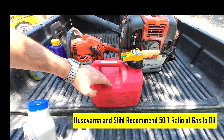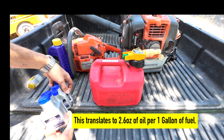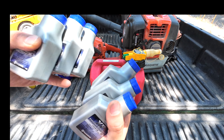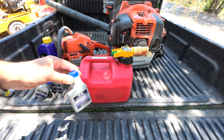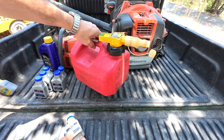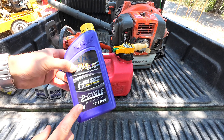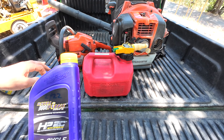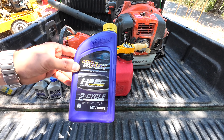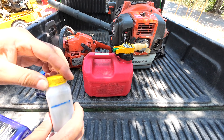The ratio is one gallon of fuel to 2.6 ounces of oil. You can get a six-pack of these Husqvarna oil containers — it doesn't really matter the brand, you just need to have a few of them. If you want to keep things very simple, you just keep buying these containers, pour it in, and add one gallon of gasoline up to the mark. That's all you need to do. I found that buying two-stroke oil in larger quantities is actually cheaper. I really like this Royal Purple synthetic oil, and I just make my own pre-measured containers. The trick is to buy one container that is transparent, since the standard ones are opaque and you can't see the level inside.